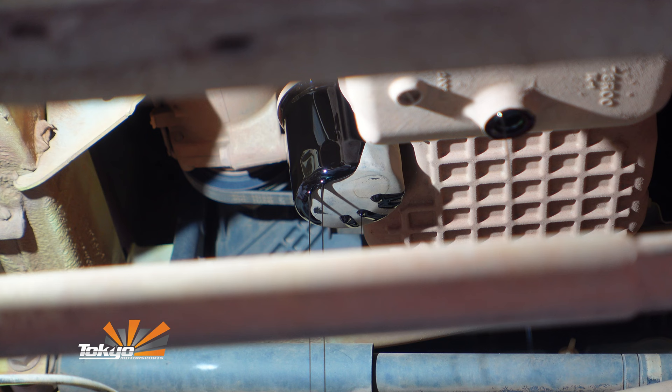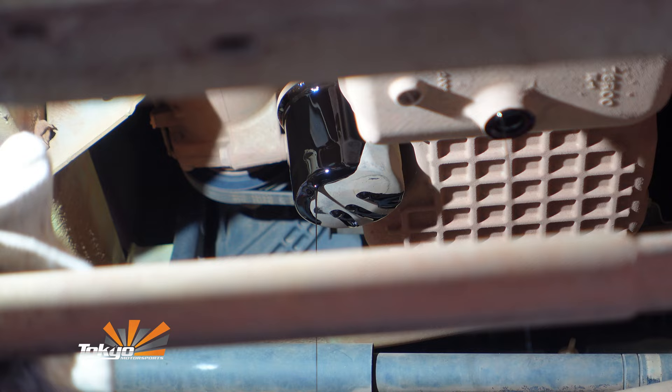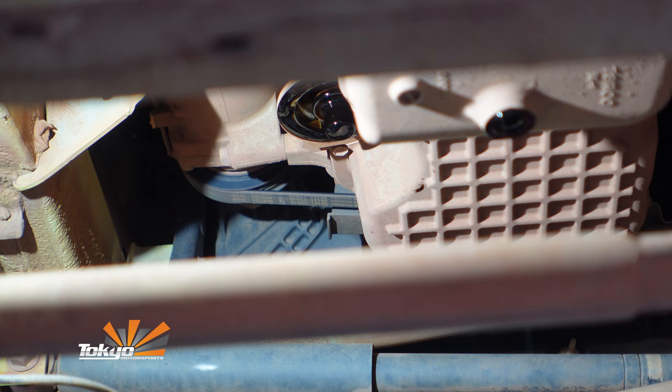Just be aware that if you are doing this at home on the ground, get some rags in there and try to mop up as much as possible. Having the oil drain out while you do the filter will allow a little bit more oil to come out of the sump, because it will move through the oil passageways, out of the oil pump and back into the sump. Leave the drain plug out when you take your filter off — you'll get the maximum amount of old oil out of the car. It's always good to have a bit of a rag, because the filter is still full of engine oil when you pull it off.